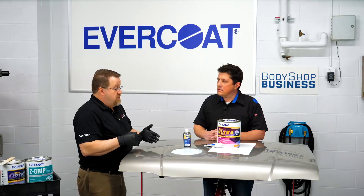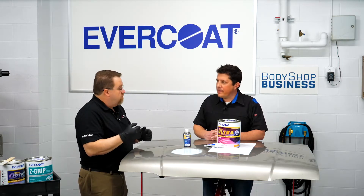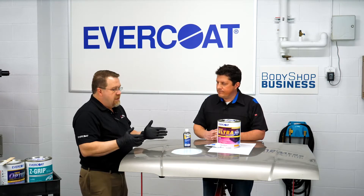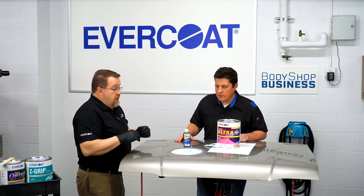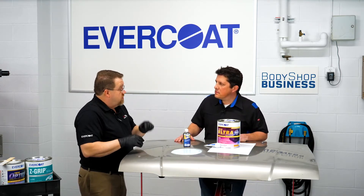If it's a water-based primer, we're going to need to let that set up about 15 minutes and give it a little scuff to make sure the water-based materials actually cure and stick properly. We've actually been hearing about 1K waterborne primers going directly over bare metal — something that was just unheard of 30 years ago, but that's the technology point we're at now. One way I've helped identify pinholes is to use an LED light. Something about the light spectrum of an LED, as you're shining it around the repair, you can actually find some of those pinholes much easier. If I know where to look, I know where to address it.